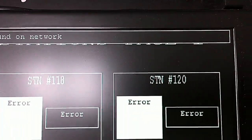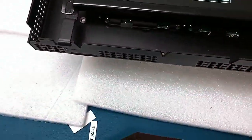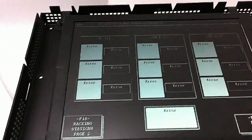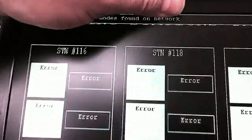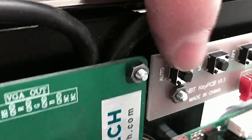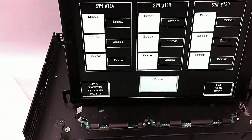Nice clear text. The reason why we're putting it on this stage is because the first time you plug it in, you're gonna have to press the auto button on the back. Before you put the screws in, you get it to this stage right here and you flip it up — right here is the auto button. You need to press that button once and it does an auto config, and the image is perfect on the screen.